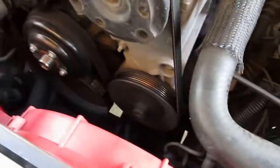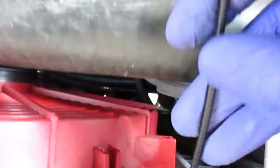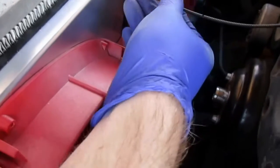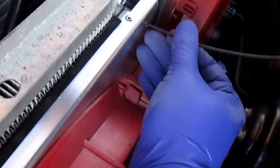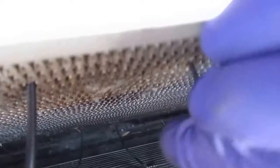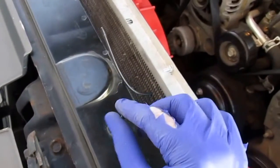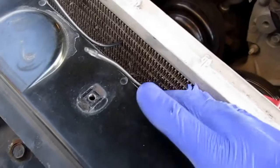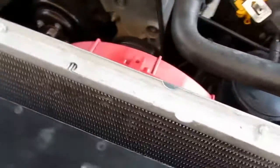For the next step, you're going to use these pieces here. You just stick it right in — I'll show you this way. You just stick it right in there and slowly work it through, and it will go through and pop out right there. Push the radiator forward a little bit and pull it on through. Then we're going to put a little rubber piece on first — since the radiator gets hot — and then the plastic piece on top of that.